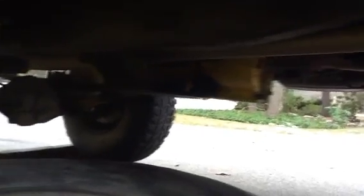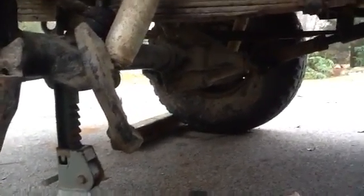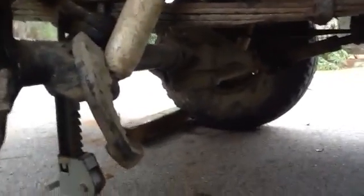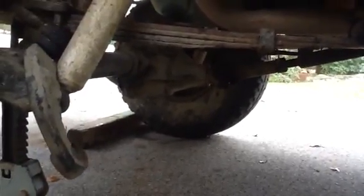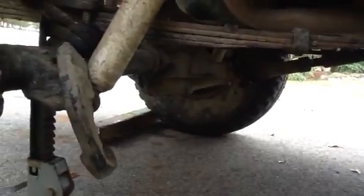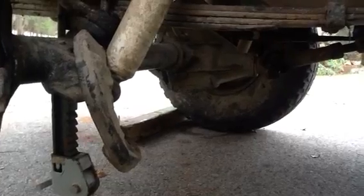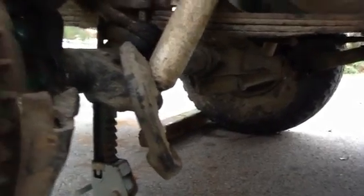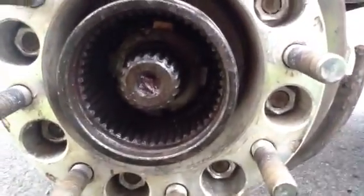If we're in four-wheel drive it's going to send that down the front driveshaft, which you can see right there, into this large object over here which is the center section of your axle housing. The center section has a ring and pinion gear in it, and basically what it's doing is taking that rotational force coming down the driveshaft through the pinion gear, then turning it onto the ring gear, which is then turning your actual shafts, sending power down this tube out through this little nub right there — that is the actual axle shaft.